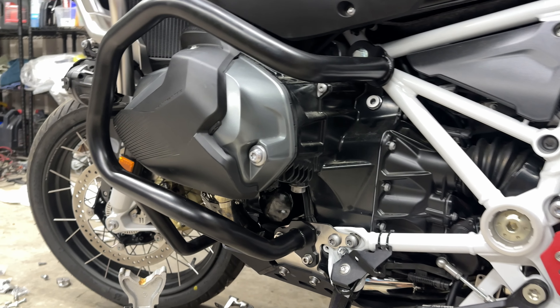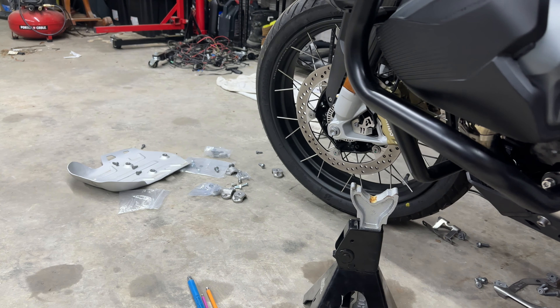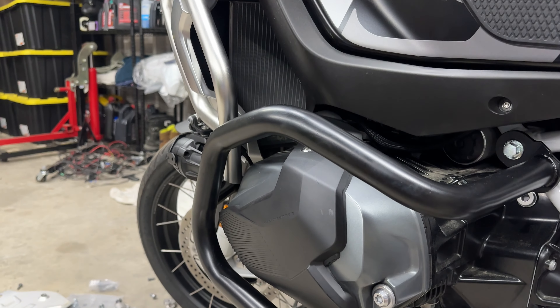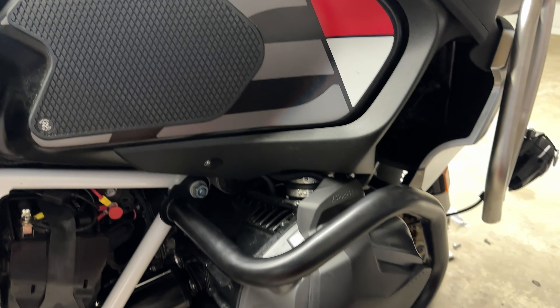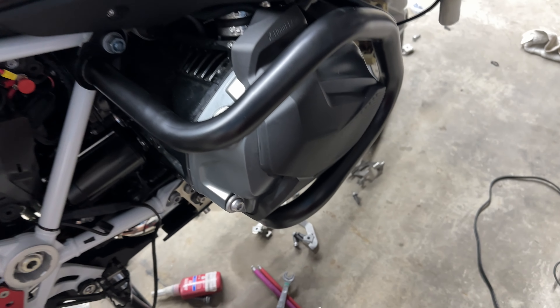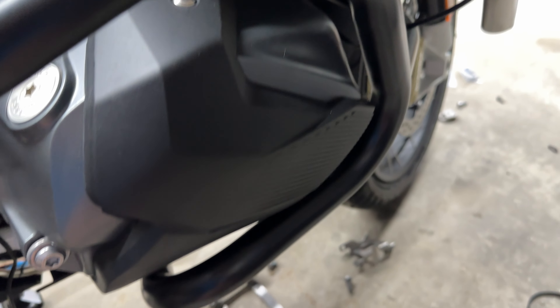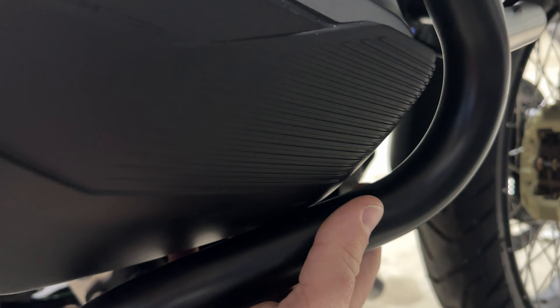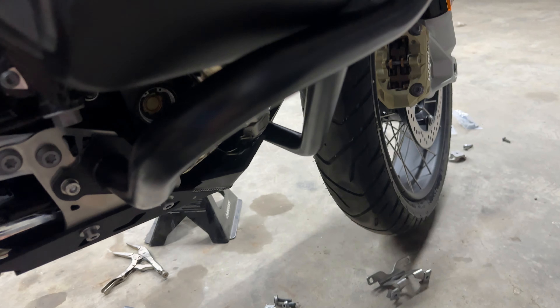Thanks for watching everyone. Actually, let's pause - I'm going to get my things together and we're going to do the install of those brackets that marry the top upper crash bar to the lower on the GS Adventure. One more note about these crash bars: a lot of people intentionally pick the Alt-Rider crash bars because you can do valve checks without having to pull the crash bars. Here's the tolerance between the hex head on the right side and the crash bars - it's really tight. I'm not sure I'll actually be able to remove the hex head with the crash bars installed. On the left side it's fine, but on the right side that is really tight. It's only a problem at every 12,000 miles, but it is a problem.